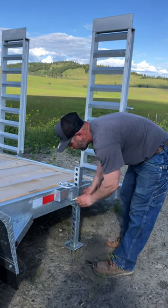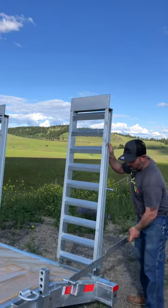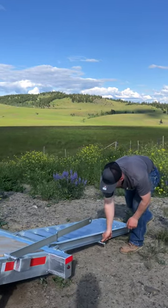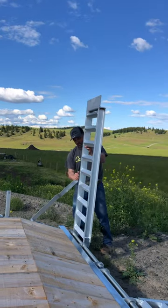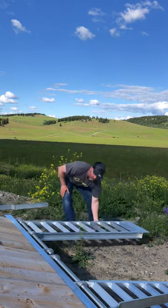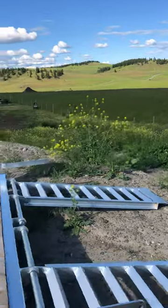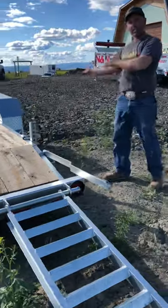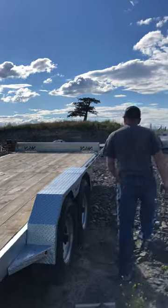You want to leave about an inch and a half drop down here. These are manual ramps — they work just fine, not as fancy, but they don't take any room on your deck. Leave that inch and a half so your suspension can take most of the weight while you're unloading, and the stab legs just stabilize your load.